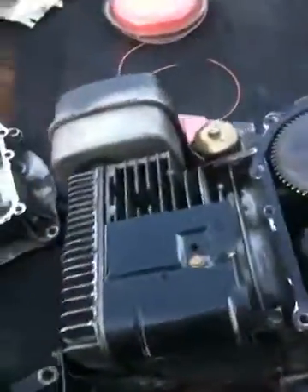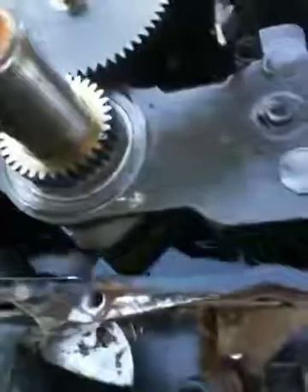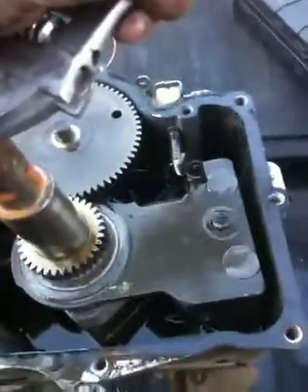I've got the spark plug out of it and the sump off. The rod's not broken, but it goes about 90 degrees and locks — I mean, tight. You can't turn it any farther than that. Turn it the other way and it locks too. Something has got it in a bind. We'll dig a little deeper.